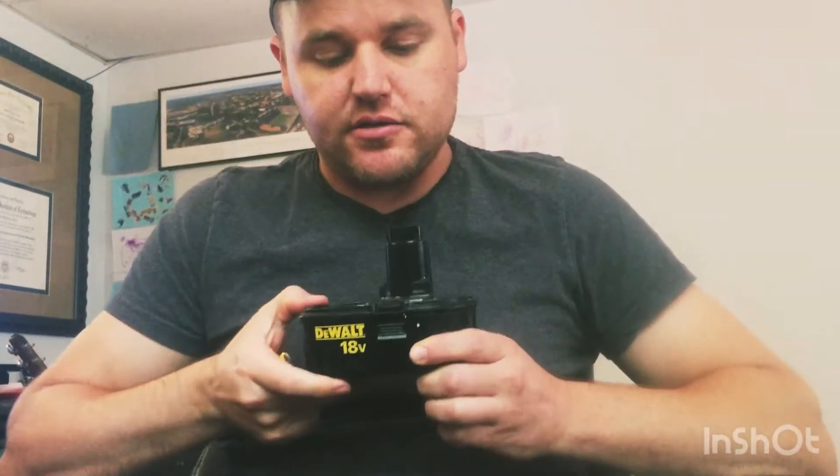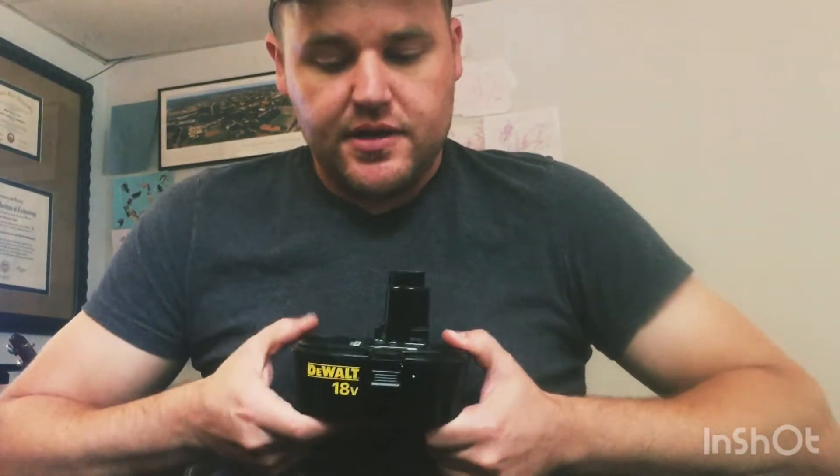Take a charged battery and be aware that it is 18 volts, while your car battery is almost definitely 12 volts — some are even 6 volts. If you're not comfortable with that power upgrade, please don't do this. It will go a little bit faster, and battery duration will be less because the amp hours of your Power Wheels is generally 12 amp hours — about 30 to 40 minutes of runtime — while these drill batteries have 3 amp hours, so about 15 to 20 minutes.